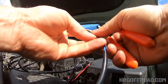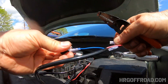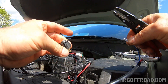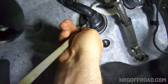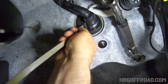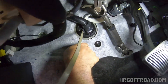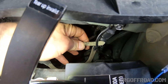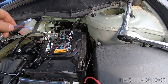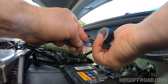Pull these connectors off very carefully. I would use a pair of pliers — sometimes they come off by hand — but if you pull them off by the wire, the wire can actually rip out of the connector and then you've got to repair it. Basically all I'm going to do is slice a tiny hole into this grommet for the wires to pass through. I'm using a giant zip tie as my fishing tool — basically anything long and thin that you can jam through there — and that will allow you to attach the wiring on the other side with electrical tape.